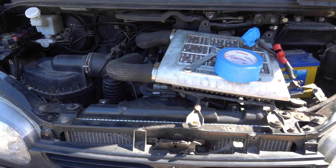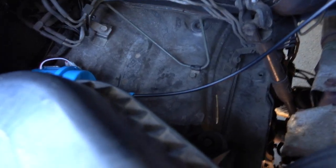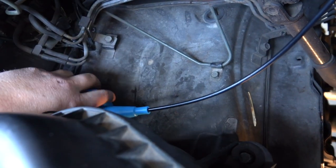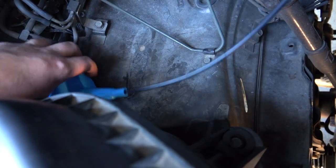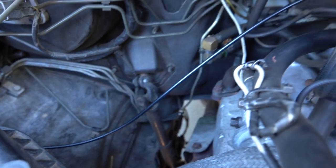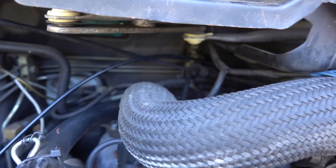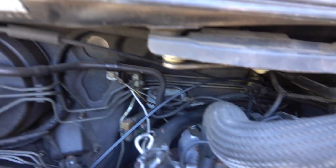Here's how we're going to fit it. Behind the air box, down here is a big flat area and you can see I've put the actuator here. I haven't quite figured out where I'm going to mount it yet, but somewhere in here is going to be fine. As long as the cable doesn't get too sharp a bend, it'll be good. Then the cable comes up around here and joins the actual throttle cable — you can zip tie it to the throttle cable to keep it following the same arc.